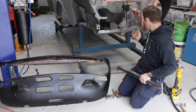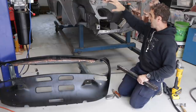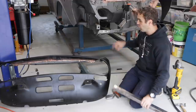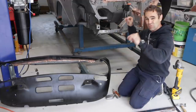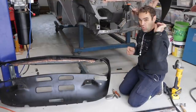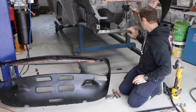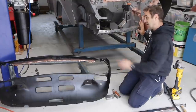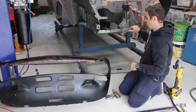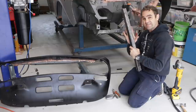You might have seen that I actually cut out this corner of this piece. Standing back and looking at my layout, my top bar is actually quite level - nice and even. I'm working off my floor which is even on both sides of the car within about a millimeter, and this is within a millimeter, so I'm using the floor as my level. It's not 100% perfect but it's pretty close. This bottom corner was out by five millimeters or so because this corner was hit, it was twisted and wasn't in the right spot, so I cut it out and re-welded it. Now it's nice and level and even as well, and they match. My next step is to actually mount in this lower section.